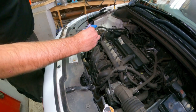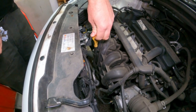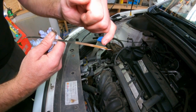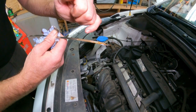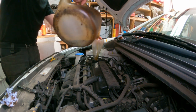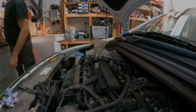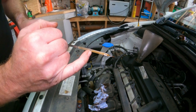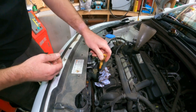This has stood for several minutes now, 3 or 4 minutes. Hopefully it's going to be a little bit low. You can see - that's the maximum dot there and we're just down there, there's the minimum dot. So I'm just going to keep putting very small amounts in until we get to just below the maximum. I think that'll do. Leave that for a few minutes and check it again. As you can see now it's just under the maximum dot - that's perfect, that's just where you need to be. Refit the dipstick, put the cap back on.